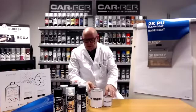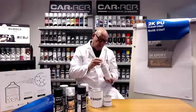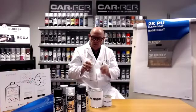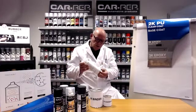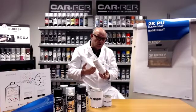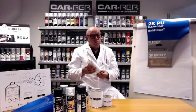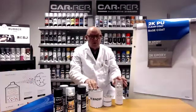That's important. Next to this, there is an aerosol on the market with 2K products, packed in principle the same way, only this has the hardener in a little tube inside the can. You have to activate that with a tool, then you puncture the capsule inside the can. The hardener comes free and mixes with the paint, the binder, the solvents, and in this case, because it's an aerosol, also the propellant. And also from that moment, the reaction takes place.